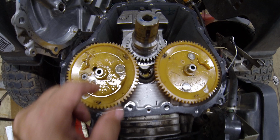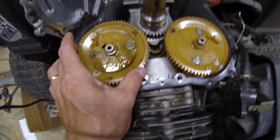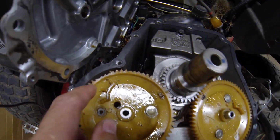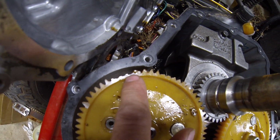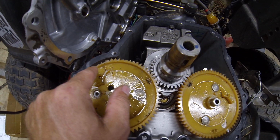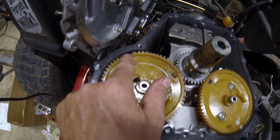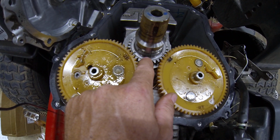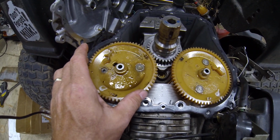So what a surprise. Nylon gears, great thing, great invention, guys, way to save money. Looking in here, to no surprise, the teeth are chopped off of this. And that's why it sounded like it was running rubber to rubber, because this spot would have been in here, and it was just spinning freely. And the steel gear was just running free through that nylon.